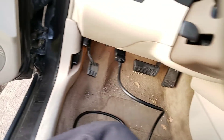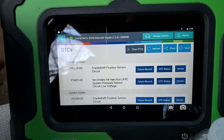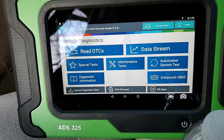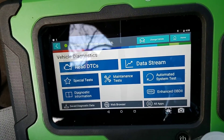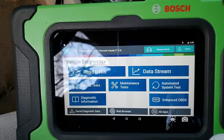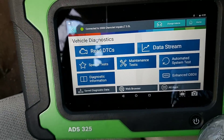I have it disconnected down there. I'm not going to try to shove my hand in there for video purposes, but as I said I did have it disconnected. Anyway, we get our 5-volt reference back and obviously this thing will start fine once I get that crank sensor plugged back in. I just wanted to bring that to your attention because not every diagram shows it all in one. If you haven't seen Pine Hollow Diagnostics' video yet, get over there and check it out - great case study. Take a look at all your information and absorb as much as you can.